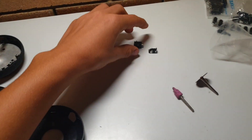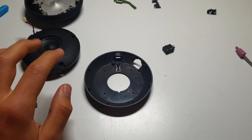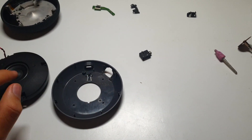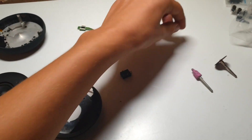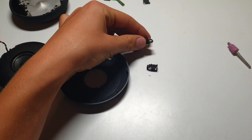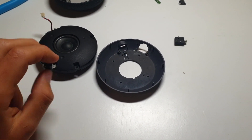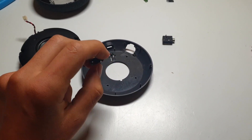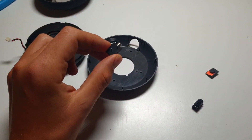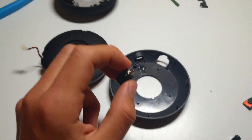When doing this you have two options. You can either use a plug that automatically switches between the Google Home Mini speakers if nothing's plugged in, and then when you plug something in it'll automatically go to the Aux port. Or you can use one of these smaller ones — the benefit is they're a lot smaller, but when you plug something in it'll still play out of the internal speaker unless you wire it up to use the mute switch. I want it to automatically switch, so I'm going to be using the larger one, which means making some compromises.